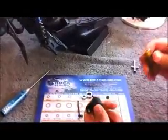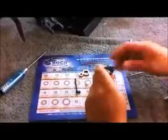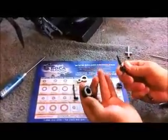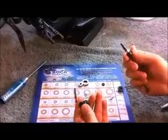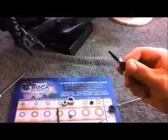Once we have it, we're going to take our flathead screwdriver again and pry up on the hex. Our drive pin already fell out. Now we should have our hub and CVD in two separate pieces. Also make sure you don't lose this crush tube in here. There's what is silver, that's what it looks like. We're going to set that to the side.